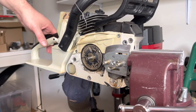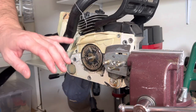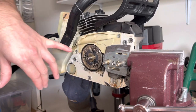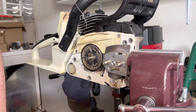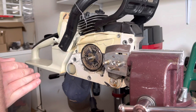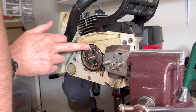So we went to around about 7,000 to 8,000 RPM. Just be aware - don't wide open throttle the engine without the clutch drum on because you're going to overstretch those springs. Around about 5,000 to 7,000 RPM is not going to cause any issues. I didn't notice any ignition advance. Ignition advance doesn't happen like 26 degrees at 2,000 RPM then jump to 29 or 30 at 14,000 - it would be a gradual transition up through the ignition advance range as RPM goes up. So there's no ignition advance on here, and we don't need to change anything.